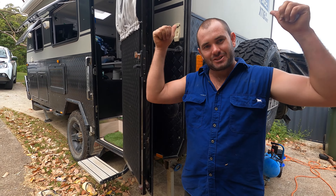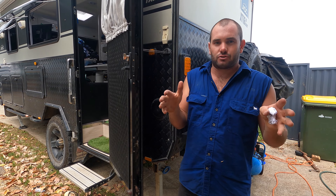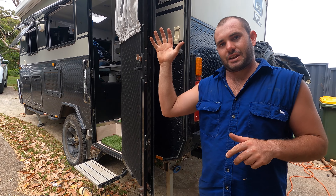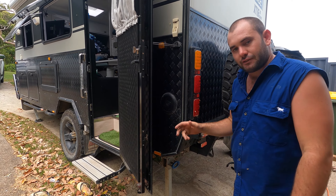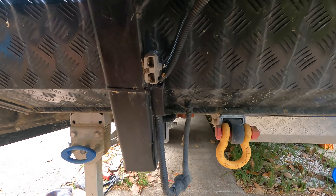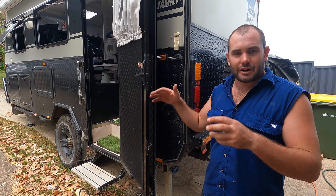Alright guys, that's it — the solar panel's up on the roof, all wired up. It's pumping out about 8 amps at the moment and it's a bit cloudy. The panel is an Exotronic 200 watt fixed panel, and max output is about 10 amps, so in full sun it'll give us 10 amps of usable power. All together on the roof we now have 500 watts of solar. And this little Anderson plug allows us to plug in another 200 watt folding solar panel, which also goes to the DC-DC charger. So all up, we have around 700 watts of solar we can use, which is more than enough for us.